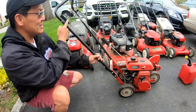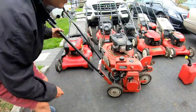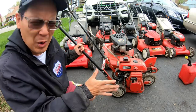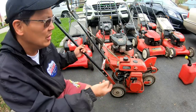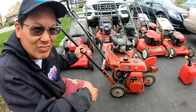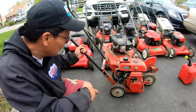We took a plastic lawnmower Briggs 550EX type carburetor and modified it to fit on the intake manifold of this Toro edger with a 2 horsepower Suzuki engine. I'm speechless - never in a million years did I think that would actually work. The throttle actually works with the throttle lever. It didn't start before because the throttle was completely off - I put it to the middle or three-quarters and it started right up. This thing works great. Maybe I'll keep it. No, I'm not going to keep it - I never use edgers, I just use my weed whacker turned sideways. I'll sell this locally for a hundred bucks.